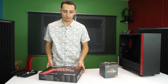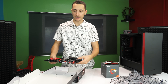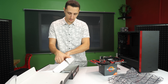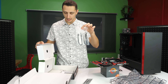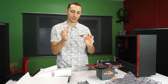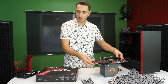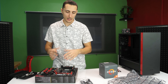Go ahead and take out the motherboard from the box. Hold onto the box itself, gently take out the sleeve, and then place the motherboard on top of the motherboard box. Take out the I/O shield from the motherboard box and your SATA cables. Some motherboards come with a tiny screw for the M.2, so if you're using an M.2 SSD, you'll need that screw to lock it in place. Once everything is taken out of the box, close it and gently put the motherboard on top. Every time you grab the motherboard, make sure you're grabbing it from the sides — do not touch any of the components on the top or behind it.